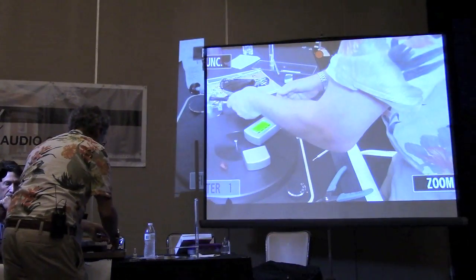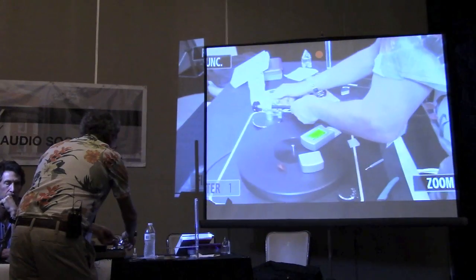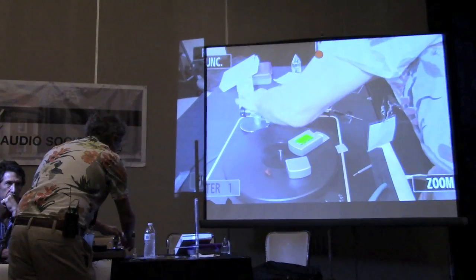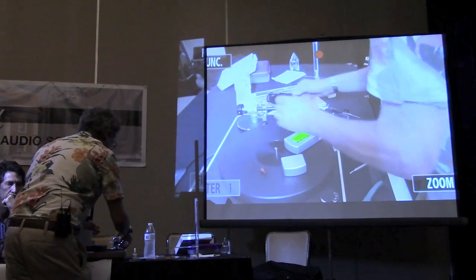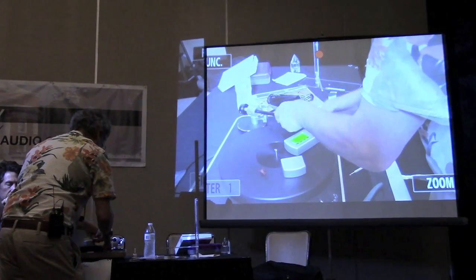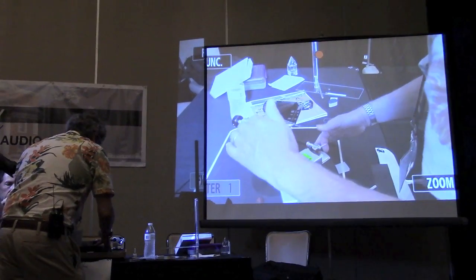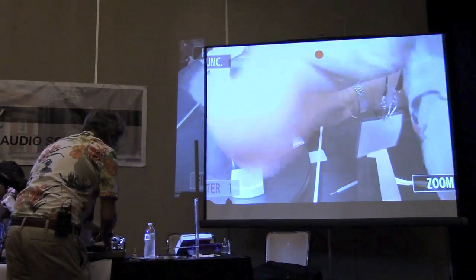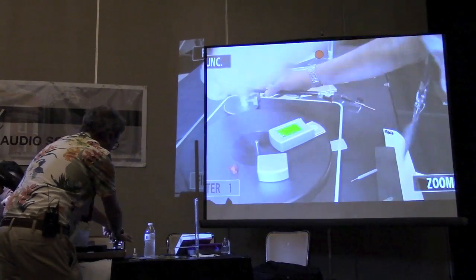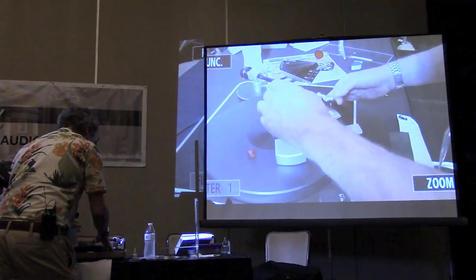And for some reason, this anti-skid. What's that? 2 grams. So eventually it's going to be 2 grams. Right now it can be anything close to 2 grams. I'm just adjusting the anti-skating, which is based on a magnet, so that the arm doesn't get pulled to the outside every time. So it's 0.59 gram. Also, I recommend putting the arm back on the rest and holding it when you do any of these things at first, so you don't slip with your finger.